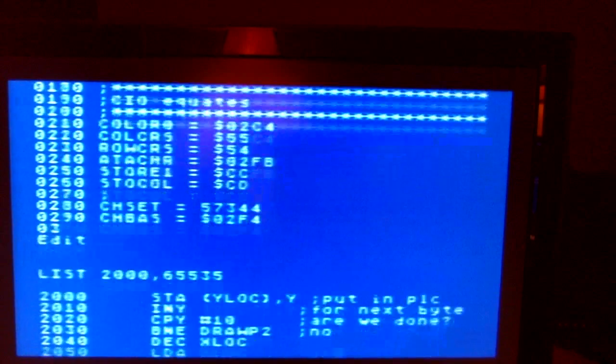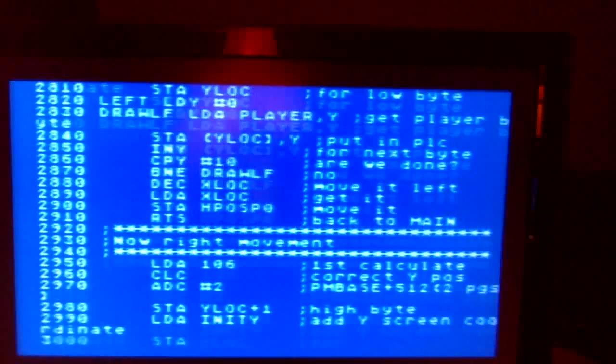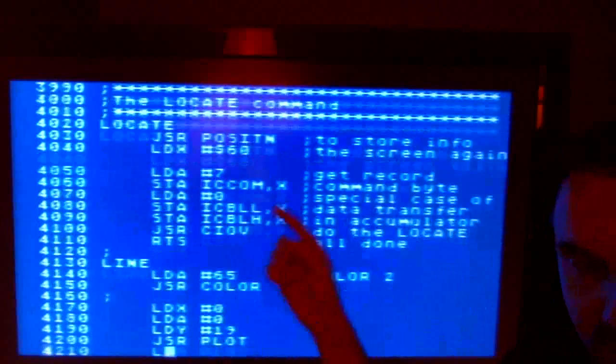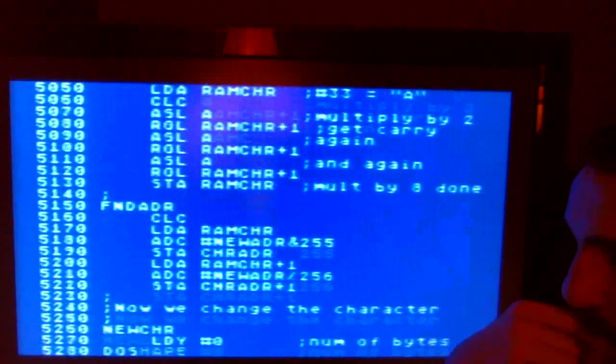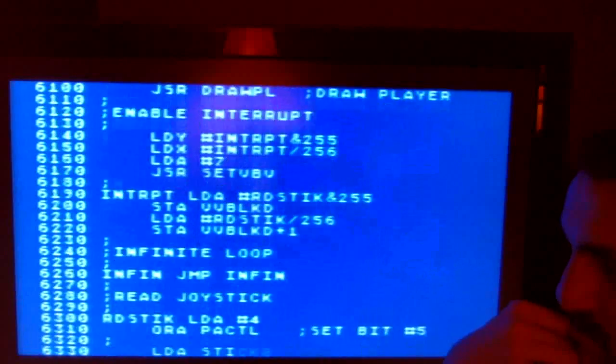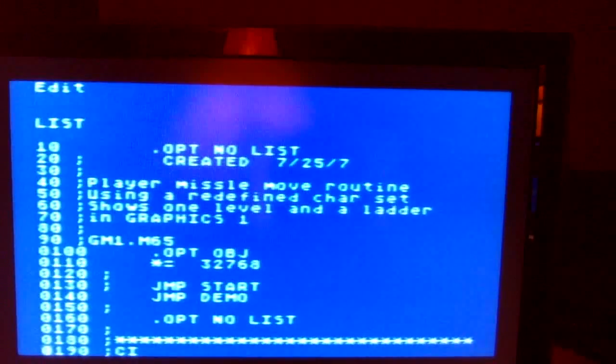I know what this one's doing. Oh boy, I wanted to show this to you. I think it's got too many lines in this first part. It runs into memory when you put too many lines in the assembly and you're not moving around the counters here. So let me see how many lines I have in this one. This is why I set it into separate files for include files and all that. Might not even be able to use this one. Let's see, it's probably going up to like 7,000 or something. Yeah, it's going up to too many lines. So basically it went over the number of lines. Well, I guess we won't be using that one.